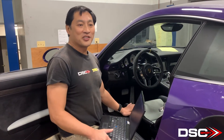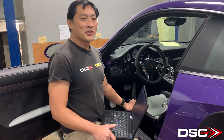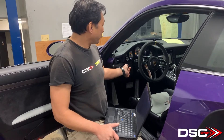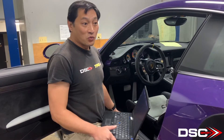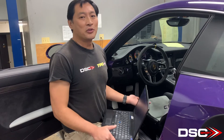Once we confirm that this car is on a flat surface and the FAL is completely deflated, we're going to turn the ignition on. Turning the ignition on powers up the ride height sensor, because without power you can't zero them.